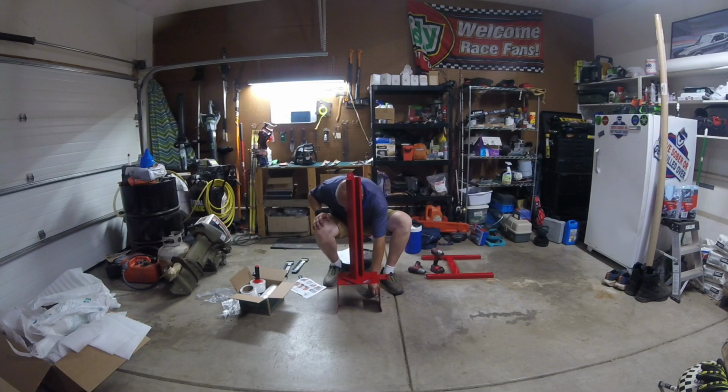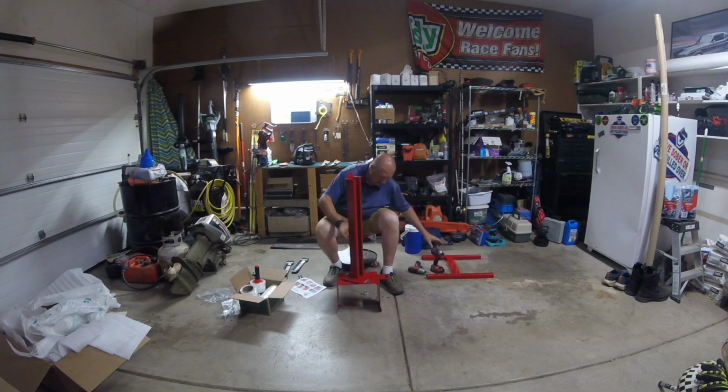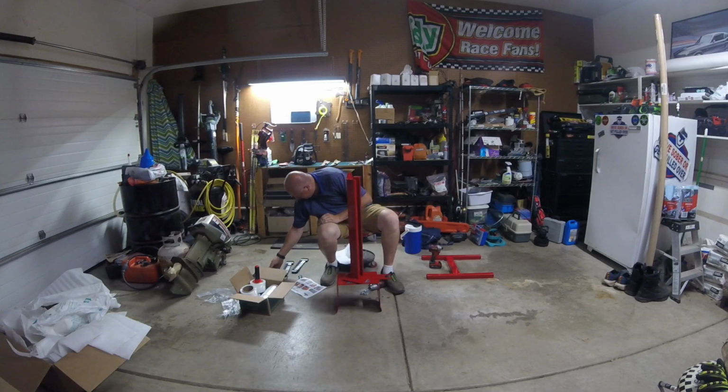Okay, so looking at the picture, they put the Allen bolt through the flat swivel part here. Allen head obviously up, and I know this is backwards on the camera because we're actually upside down here, but you want the Allen head on the top side because it's got to have clearance to clear that there. Looks like this is just snug enough. I'm going to have to run it through. There we go. So we'll put the nylon nut on, hold that in place, and that's the 7/16.